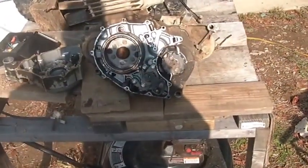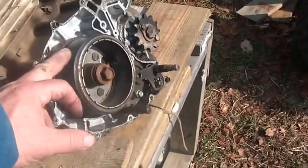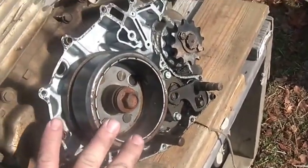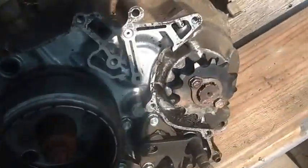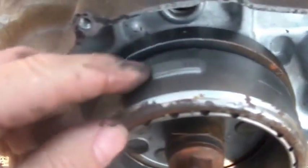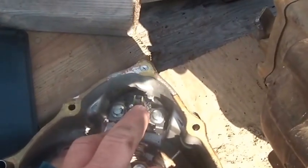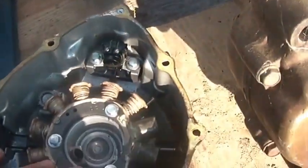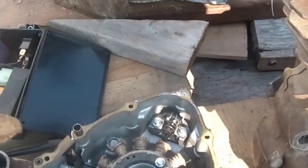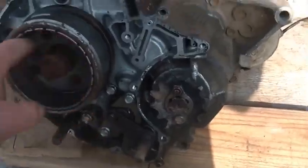Anyway, you tear it apart. Let's pretend you really want to go Mr. Cheapo on this whole affair. If I were going Mr. Cheapo, I'd leave the current flywheel in there, clean it up, and leave the flywheel right in there. I'd take the stator out but leave the pulse generator in. This is the pulse generator, and here's the magnet that triggers it — you can see nothing should be bothering those. You'd have to remove the wiring very carefully — you don't need to be clipping these wires. One wire is yellow and blue and the other one is green. Sometimes the green has a white stripe on it, but this one looks like it's just green. You just have to make sure they still come out here, then get the stator right out. Now you can turn this around freely and any metallic stuff will just get stuck on the inside here.